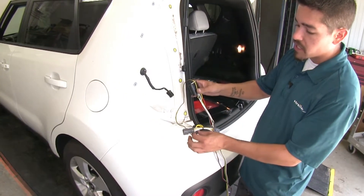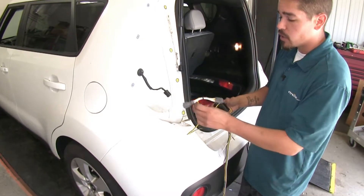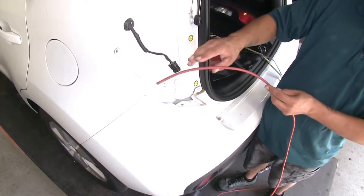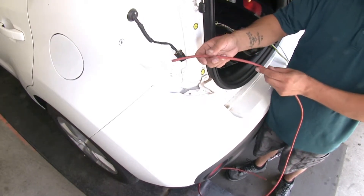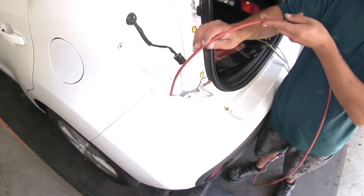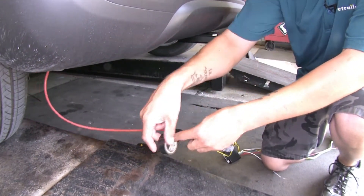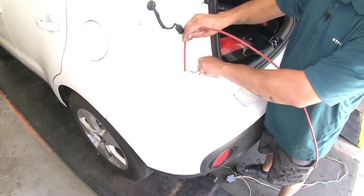Now if we come to our wiring harness, the yellow and brown connector is going to be attaching to our driver's side. I found it easier to have something come down so we can pull the harness up. I'm going to take a piece of airline tube to fish it down through the bumper and the body of the vehicle. If you don't have airline tube, you can use whatever you have lying around that'll keep its structure, like a coat hanger. I'll feed this down and once it reaches the bottom of the bumper, I'll attach my yellow wire and tape my connector to the tube so I won't lose it when pulling it up. You may need to pull on the bumper just a little bit to help get the connector through.